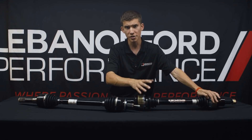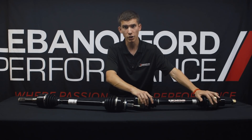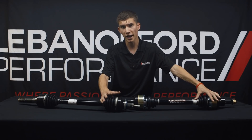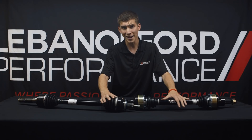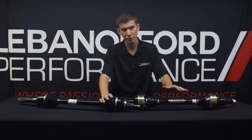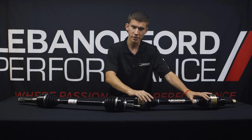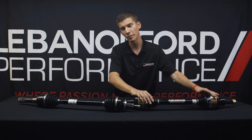You really don't want to be the person who snaps a half shaft on the line at the drag strip and has to get pushed back to the pits, or worse yet ends up on a tow truck on the way home. For those of you looking into our performance Mustangs — our 700, 750, 800, and Hellion Mustangs — we strongly suggest doing these upgrades, especially if you're moving to any ET street radial, cheater slick, full bias ply, or any 100 tread wear tire or less with drag strip use in mind. If you have a manual transmission, seriously just go ahead and do it. It's definitely worth the money — you're going to break them at some point.